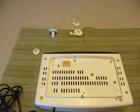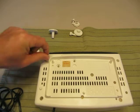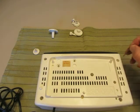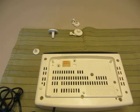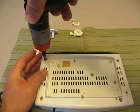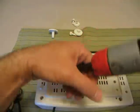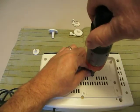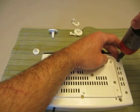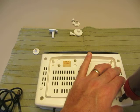We've previously put in the screws for the clock motor, which was important to make sure it was seated properly. The way you know it seated properly is that little post — where it turns the flip numbers — should be centered. Now I take my five screws and drop them in the holes. Please don't over-torque these; if you over-torque them you will break the plastic, and there's really no good fix for that. Once it starts to get a little tight, I stop. You can feel the gradual buildup of pressure — it does not need to be torqued down, it just needs to hold the clock in place.